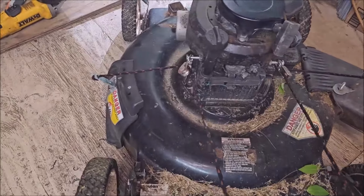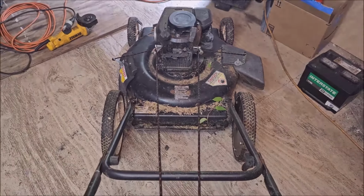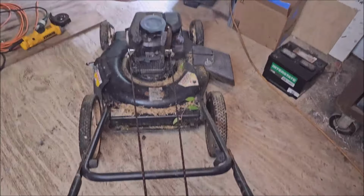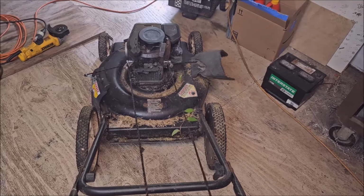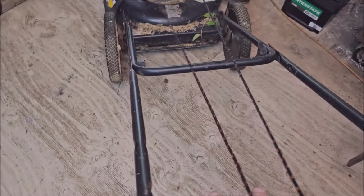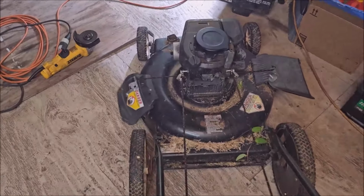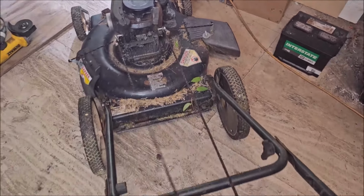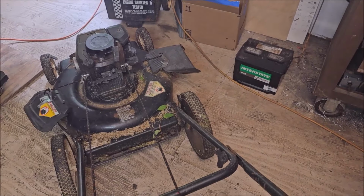Man, I got old dude all assembled, with a little bracket attached to him there. I'm pushing this lawnmower and everything's normal. I got this little rope on here to operate the discharge chute when things get full or you're getting some tall grass. But when I went backwards, I could pull on this side of it and open that door. But the spring on that door is twice as strong as the spring on this door. So when I pull on it to go backwards, I'm opening that one up.